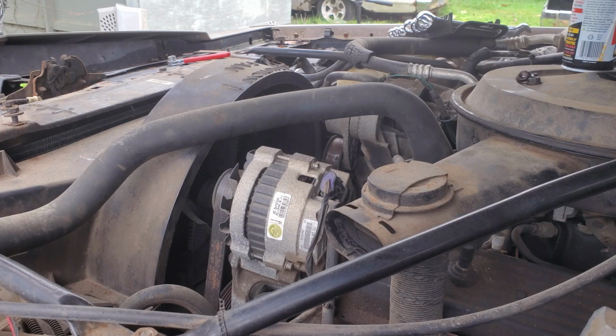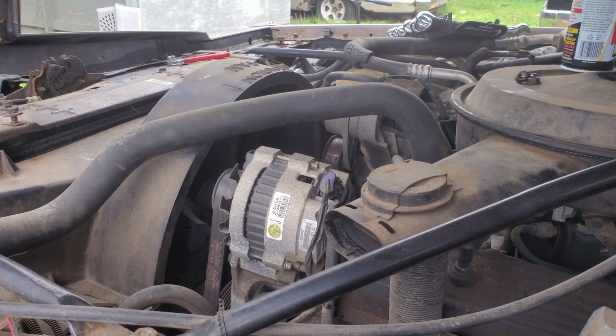Well, I crawled back under there to see. That bottom piece actually does sit under the radiator. But it also bolts to the core support, which is kind of odd, I guess. Maybe not. Anyways, we're going to pull this off. Try and pick up the radiator just a hair. Let's pull that out. Worst case scenario, we're just going to split this fan shroud in half.